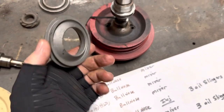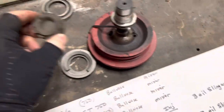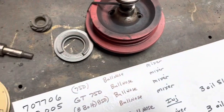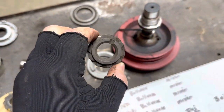The Monte Carlo and GT front parts are really rare — do not lose them. This is a special front nose piece; it's the same as the mixer piece only it's flat. Here's the gear: we've got a little groove cut in it right here — that's all we've got. We don't have a keyway cut. That's how we can quickly tell a Monte Carlo and GT from a standard gear.